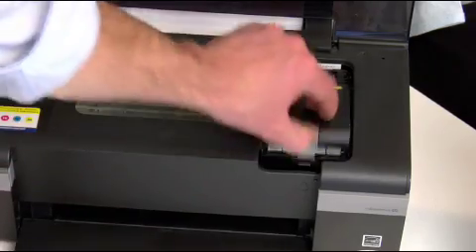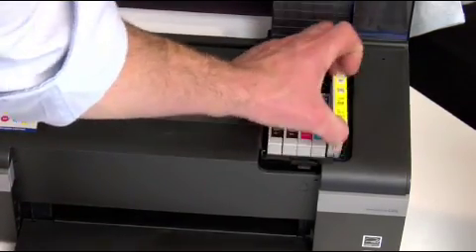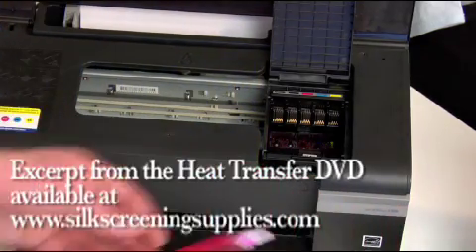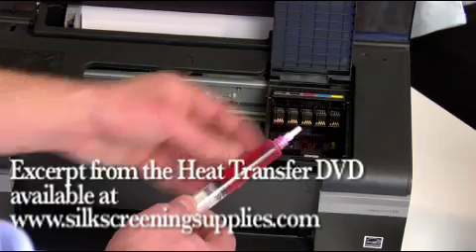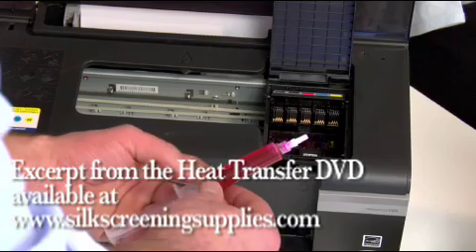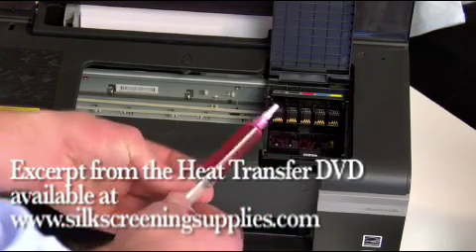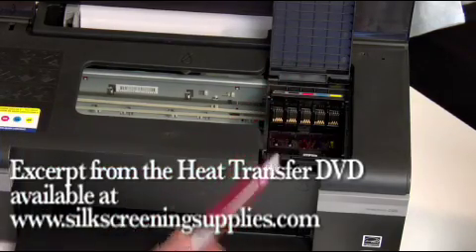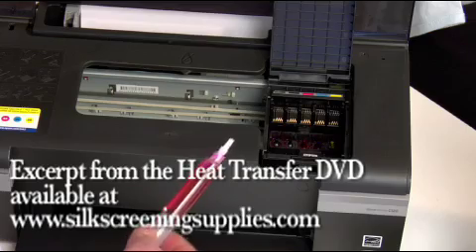Once it's in the replacement position, take out all the print cartridges. Remember which channels you're having problems with, so keep your most recent nozzle check paper in front of you. We're going to be using a special syringe provided by Sawgrass to manually flush the print nozzles. We have an HD print head nozzle cleaning solution available through Rionet, or you can also use Simple Green. When using this, be extremely careful — if you spill solution on any electronic components it will fry your printer, so make sure your syringe is sucked tight with no air or solution dripping out the edge.